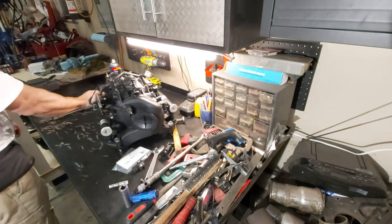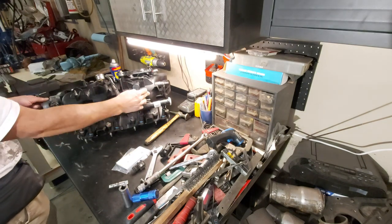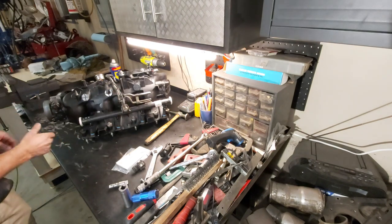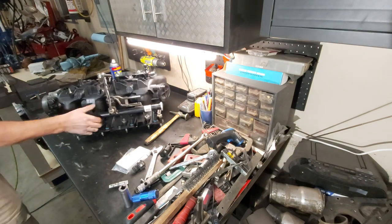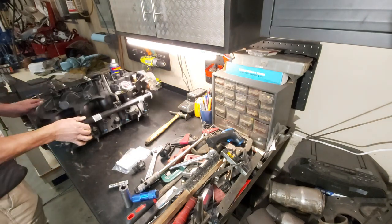And again, see if this factory style fuel feed, 5/16, 1/4 inch return, can keep up when the boost comes in. So anyways, it's just an experiment, but we'll see. So we'll all learn something.